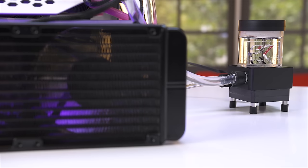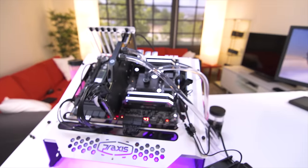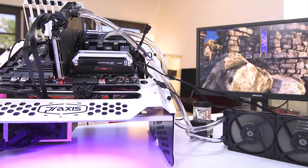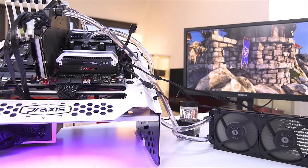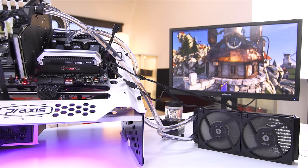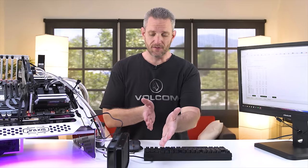Right now, this has been running for a while, and we are sitting with the temps averaging anywhere between 58C and I see 70C on the cores. Max we ever saw in here was 78. So pretty much the same as what we were seeing with the triple radiator solution. And this is a thinner rad made out of aluminum and it's smaller.